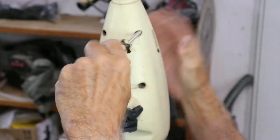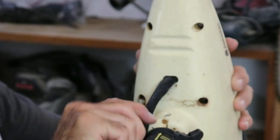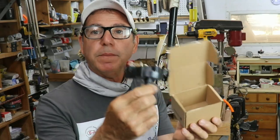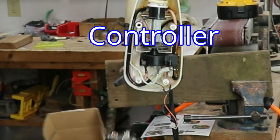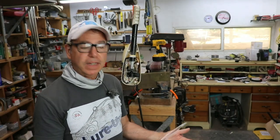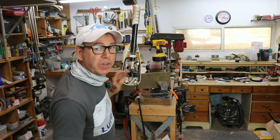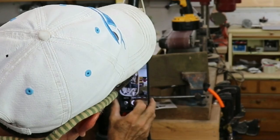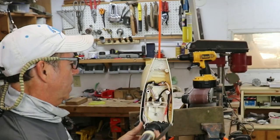Let's tear into this. It's pretty clean in there. Here's the replacement part they sent — it's the speed controller, easily identifiable right here in the motor. They also sent a really nice instructional card: it's laminated, it's in color, it's step-by-step. They suggest you take a picture of the assembled motor head so you can reassemble it the same way, and I always do that.